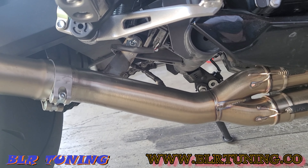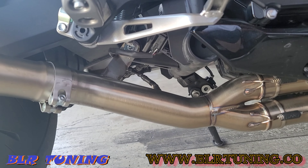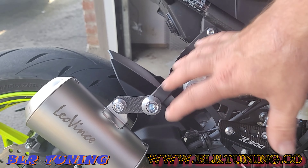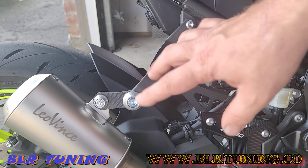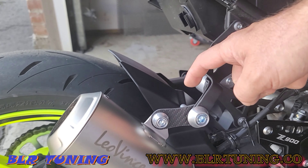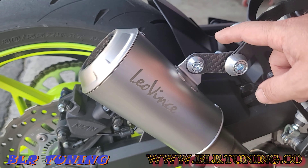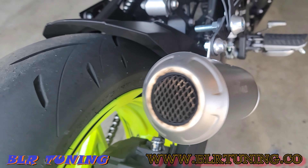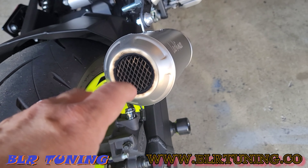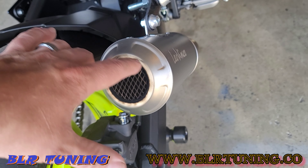You can clean your pipe with some alcohol. Some people rub it down with WD-40, which will get it to change to that nice blue color. We're going to just wipe it down with alcohol to get rid of our fingerprints. You can see the Leo Vince exhaust back here. We had to build a hanger because we didn't want to use the rear peg setup — later on we'll change this to something we're going to try and manufacture. For now it's just some aluminum brackets we made. Our bolt was a little bit too long, but we have a little rubber bushing back behind here. That smaller bolt looks really nice with this little carbon fiber piece. The only downside to using the brushed stainless is you can already see just a little bit of black around it — we were still working on the tuning, so she was running a little rich when we took off. It's all dialed in now, but you're going to get this blackened area over time — that's just inevitable.